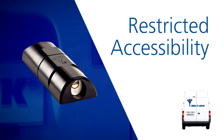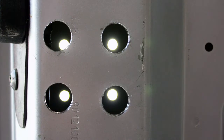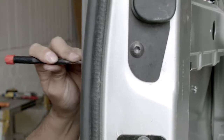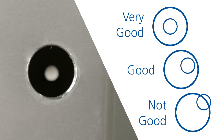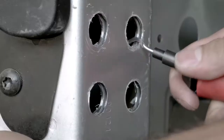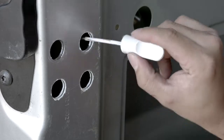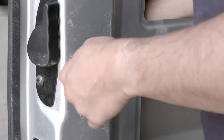How to install the lock onto the fixed door when we have restricted accessibility. With restricted accessibility, we need to create access points to allow simple installation of the armoured lock unit. Using a pointed pin punch through each of the drilled holes, mark the inner skin giving a good guideline where the access holes need to be. If it's not possible to mark the inner skin, we will need to make calculations where these four holes should be. These holes are for access only, so they do not have to be perfectly in line with the holes in the door skin. However, they must surround the door skin holes completely. Once these four positions are identified, we can drill the holes using the step cutter. Each hole should be between 20 and 21 millimetres in diameter. As before, we will clean the holes using a deburring tool and use the automotive touch-up stick to address the bare metal. At this point, the fixing of the armoured lock follows the same process as before. Once tightened, install the four finishing grommets.